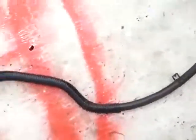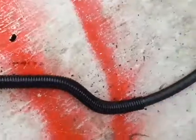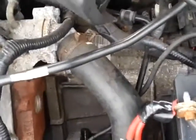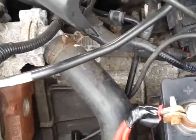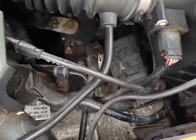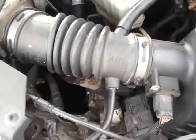One last thing I forgot to mention. So there's the actual line — the cooler transmission line. The reason I got suspicious or knew I had an issue with the transmission is because when I went around the corner, it kind of cut out a little bit. So when you go around corners and the engine's not working properly, or it seems to cut out on you, you want to start checking your fluids.